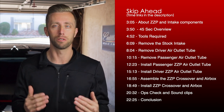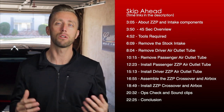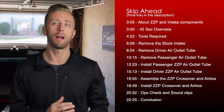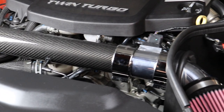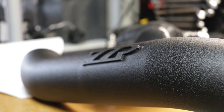The V-Sport is a little different. On a stock V-Sport, the ECU sets power goals — horsepower and torque are set to 420 horsepower and 430 foot-pounds. If it sees potential for more power it will limit horsepower by closing the throttle, adjusting boost or timing to stay at 420. With a tune it raises this bar, but we haven't really seen significant horsepower improvements using an intake. My best quarter mile time is still on a stock air box with a Trifecta tune. ZZP doesn't make horsepower claims and Trifecta hasn't chimed in on combinations either.